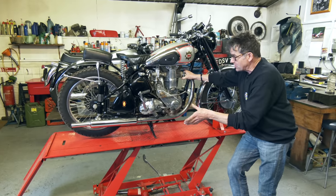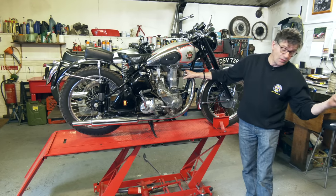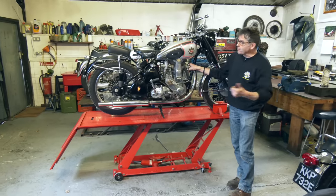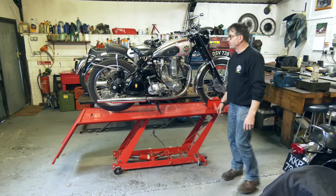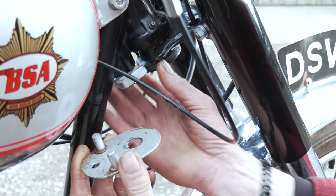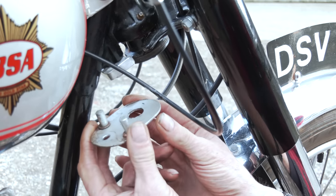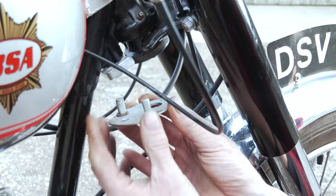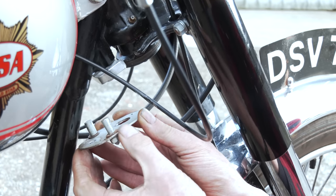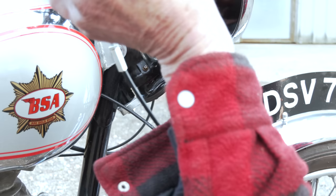It's the bike for someone who always wanted a Gold Star but could never afford one back in the day, and now feels they're too old for a DB34 in Clubman trim. You could put a DB34 in Touring trim, but that's a much higher-priced bike. This is half that price — still a goldie. I want to show you what we've done to improve the steering stop. This billet aluminium stop is clamped underneath the frame. What was on before was homemade — two thin pillars that could easily bend. This is a lot stronger. Turn the bars and it's solid.